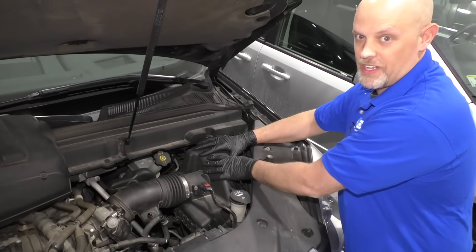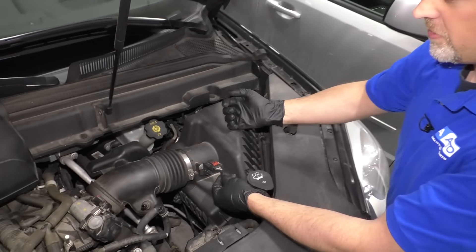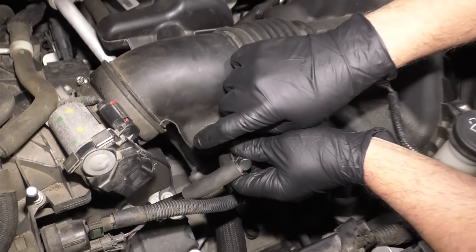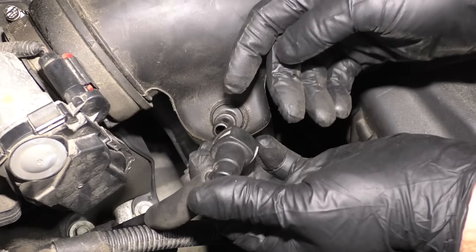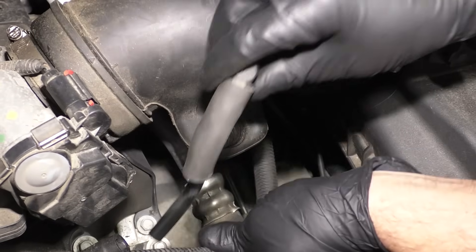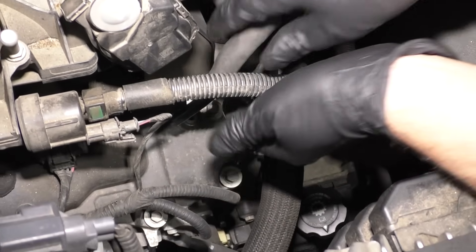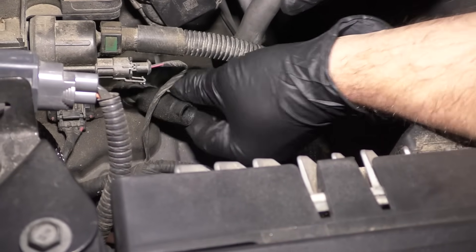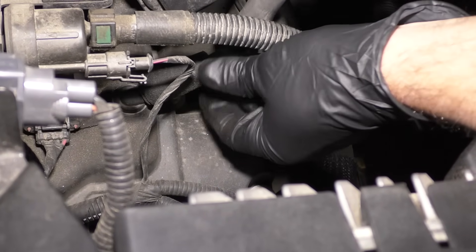On a different vehicle, the air box is right here where the air filter is. There are the wires, and if you follow the snorkel, there's actually a hose that's supposed to be right there. If that was left off, that's going to cause that code. Or even if you check and see it's disconnected right there, that needs to be hooked up. Hook that up and clear the code.